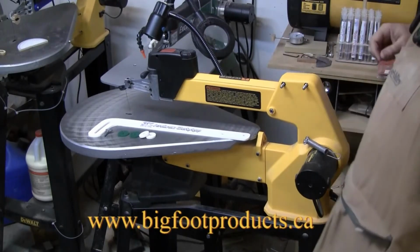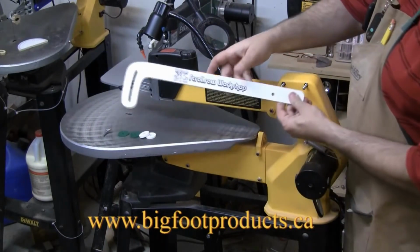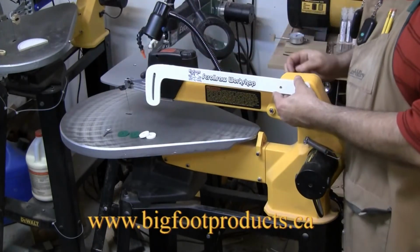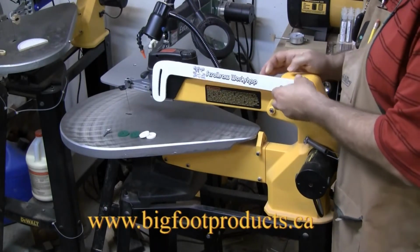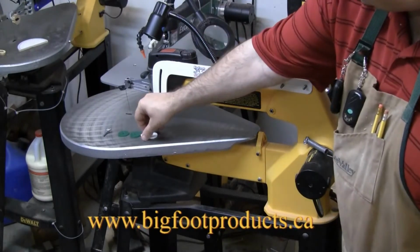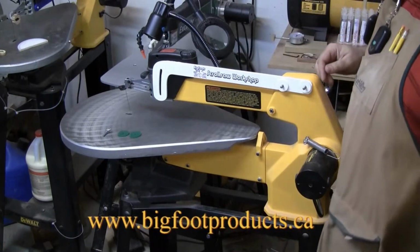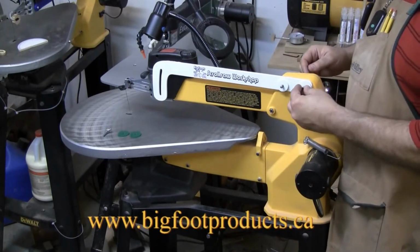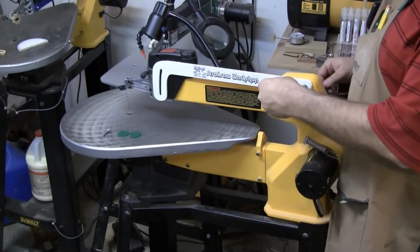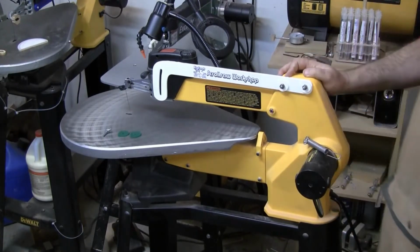And now we're ready to install the lift and lock arm. Take the arm and the 2 holes that are in the back, making sure the hockey stick's pointing down, and just slip them right over these 2 bolts we just installed. Now what we want to do is take the 2 white washers that come with the kit and put one on each of the bolts. Now we can take the nuts that came with the kit, run them up, and they just need to be snug. And we've got the back part of the kit already installed.